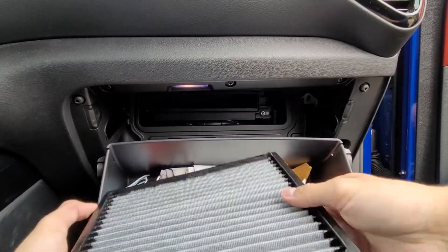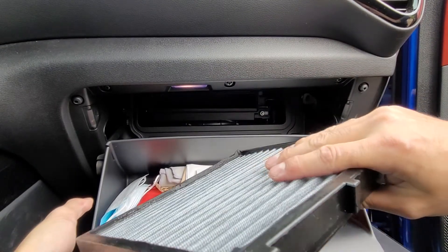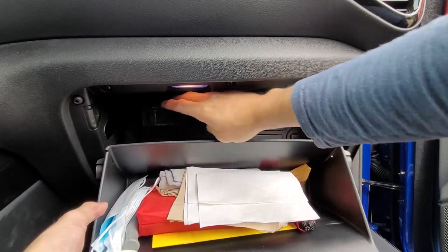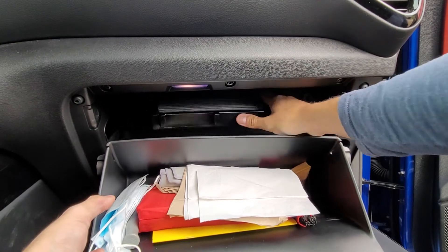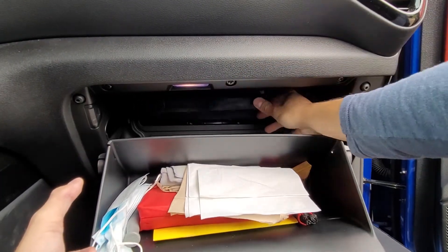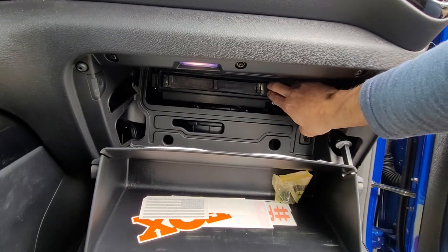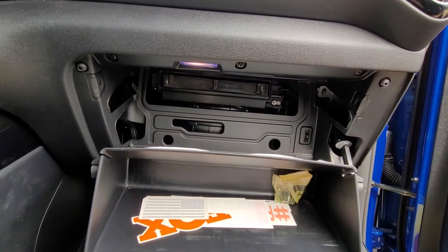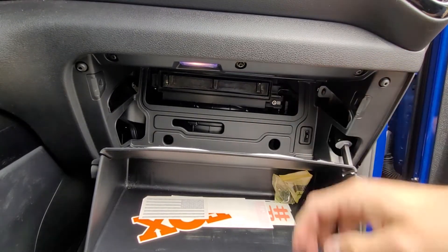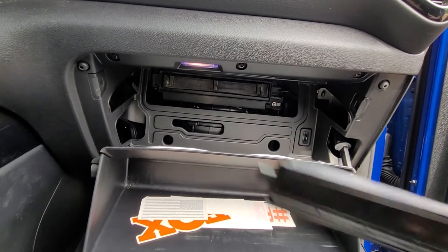You can see this filter has a bit of a dish, a little bit of a lip here, and it's got these three fins. These three fins make it easy to pull the filter out, but they are going to be the part that is sticking out towards you — and you're not going to be able to see the K&N logo. You just push this in. This filter is a little bit more rigid, but it will go in there. Don't worry if it gives you a little bit of resistance. Once you have it in there, you are going to put that little lid back on.